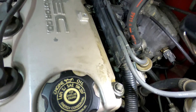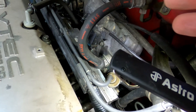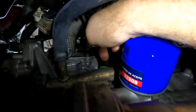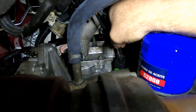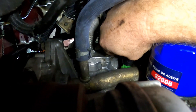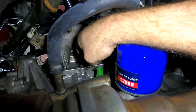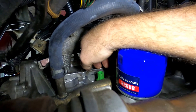The only way you can get to it is to get up underneath the car and jack it up as high as you can. Here I am laying up underneath the car — this is the back of the engine. Here's your oil filter to give you some bearing. If you go above the oil filter, you have your water tube that runs across, and then above that is your knock sensor. Right here is the connector — it has a green backing on it and a little clip connector. We're going to squeeze and pull that off. I'm not going to be able to do this on camera, but we're going to put that 24 millimeter socket on that, get our wrench up there, and just get it cracked loose. After it's loose you should be able to spin it out with your fingers.